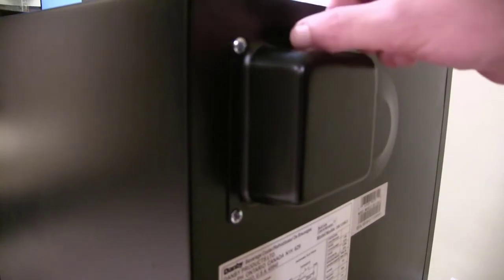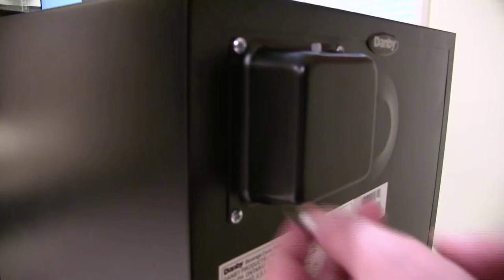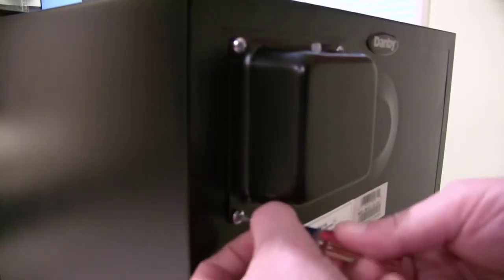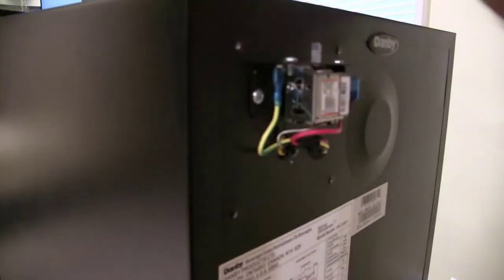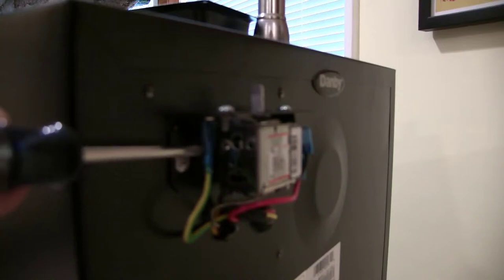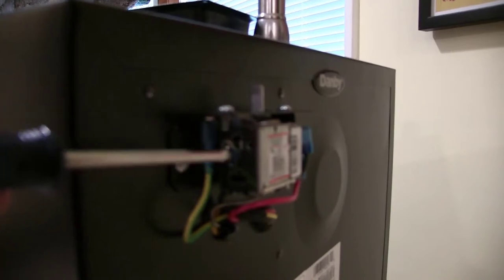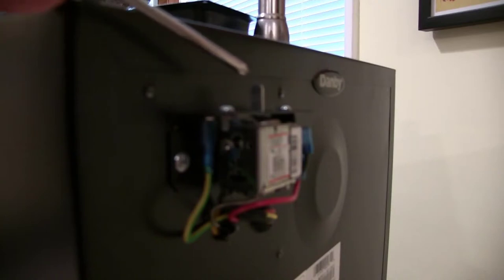We have to take the box off, so pull the little adjustment lever straight up and off, and then take out the four screws to get this cover off. Now with the cover off we can see where that screw is — right here. You might need to pull this wire off its terminal for easy adjustment. Think of this screw as the coarse adjustment for the temperature control, and your knob on top is more like the fine adjustment.